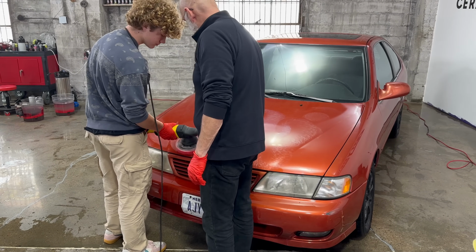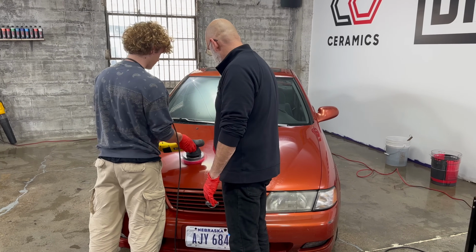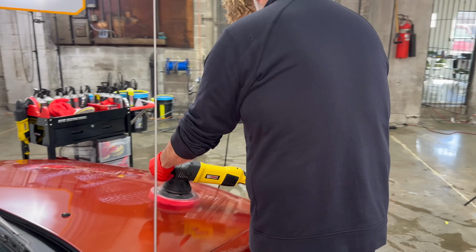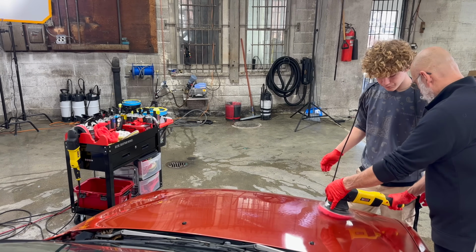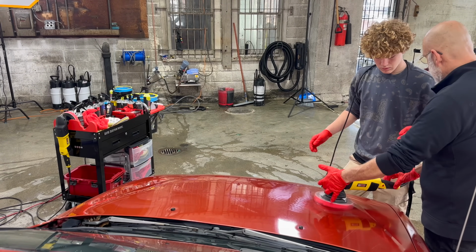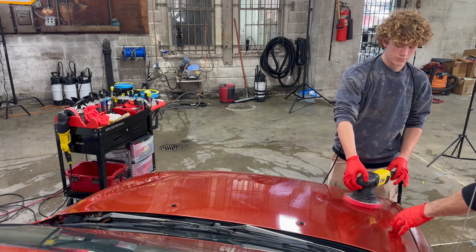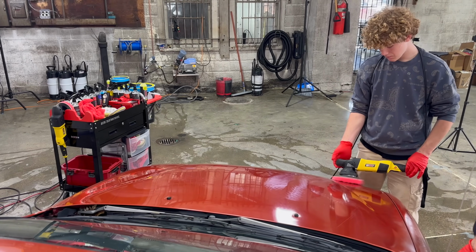You see this? Your pad is stalling because you had it on a really high angle. Oh, okay. But if you can keep your pad flat, let's help you out a little bit. Hold on to it like this. 2 fingers here, 1 finger there. Because when you're holding on with your hand, your body automatically tenses here. But if you're doing this, you're not going to tense up. Don't go over here because of the clear coat failure. So a little easier to control that way. Yep.